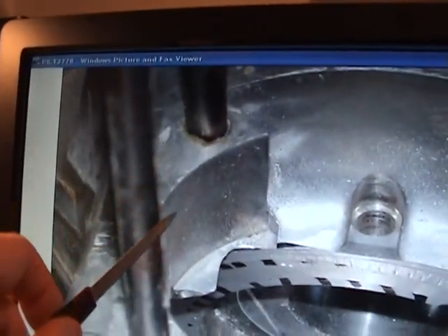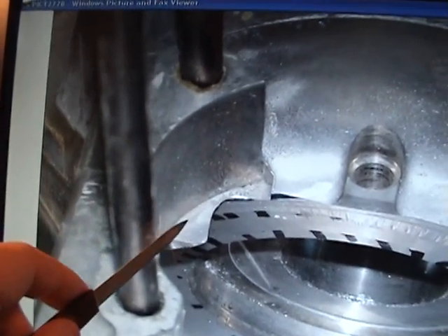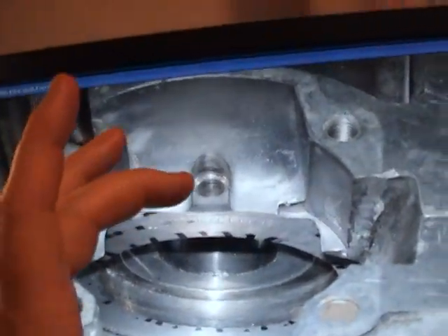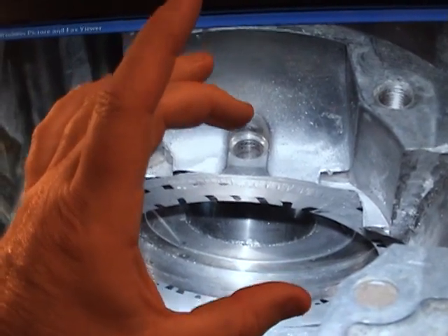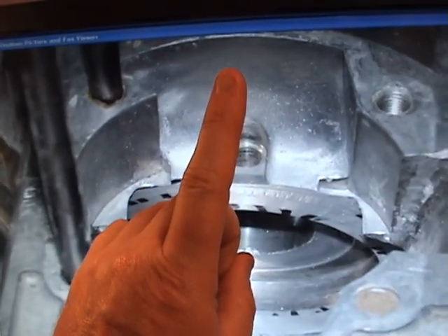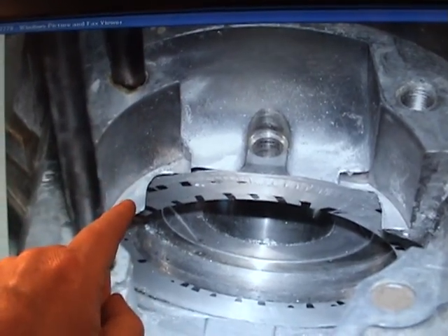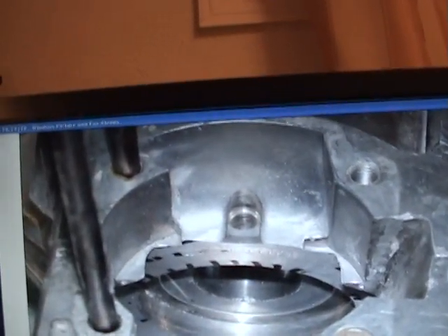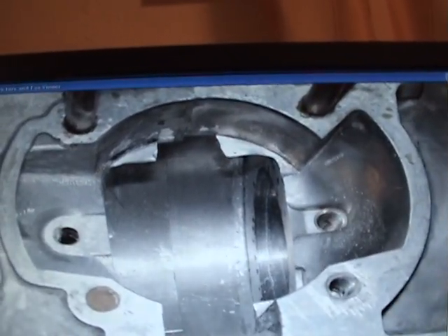Now I'm starting up on here. This area right here will have to be taken down — not all of it, but there's a reason for that. Remember, the crankshaft is a bigger diameter — the crank wheels and weights spin a bigger circle. As it pulls the piston rod down farther, the edges of the piston can hit here, or here, or down over there. If those pistons hit that area at speed, the piston will shatter and your motor will just be a big paperweight.